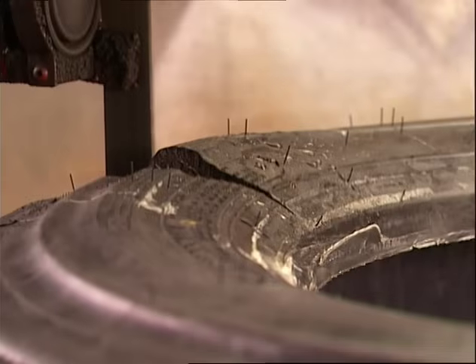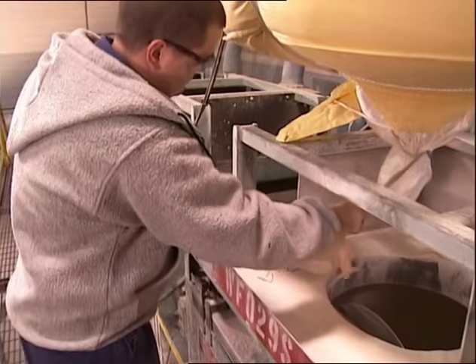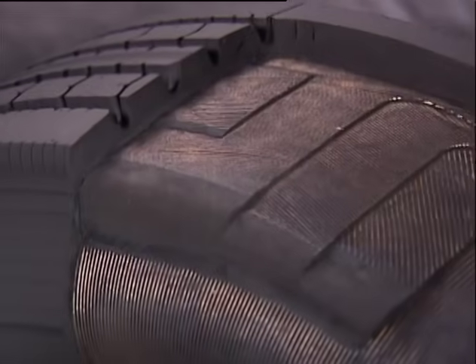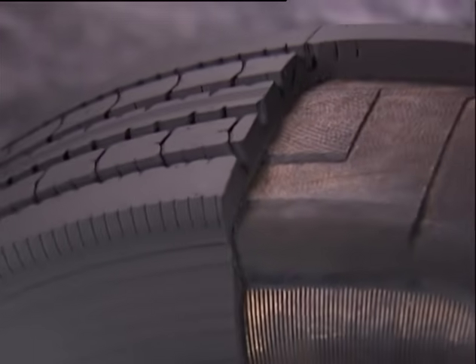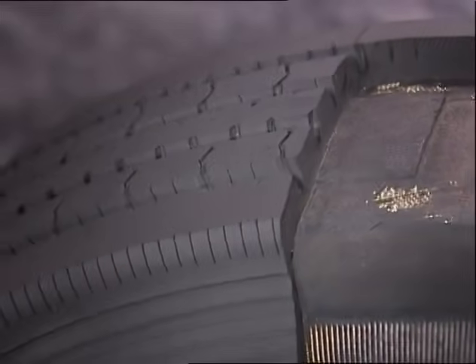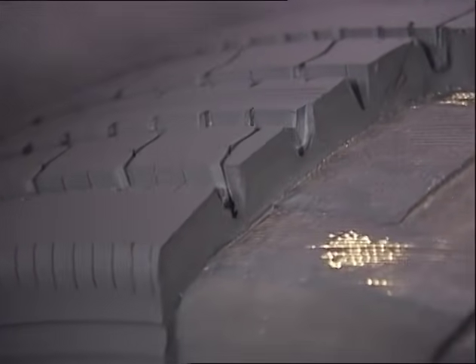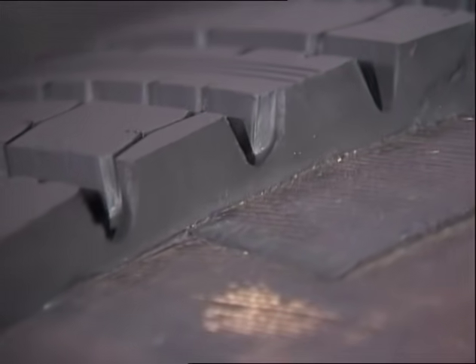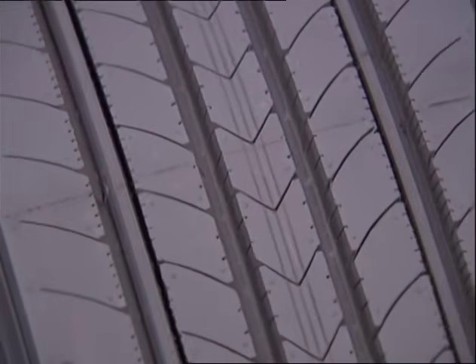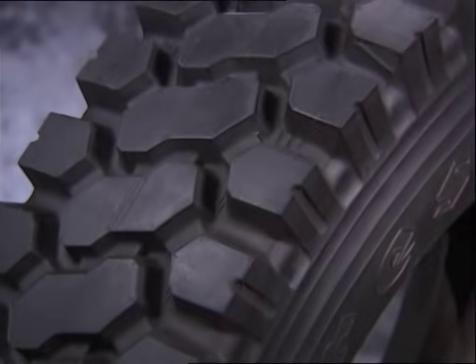To find out, we'll look at what's inside it. Then we'll see what goes into the making of a modern truck tire. We'll start at the outside. The tread, of course, is a thick layer of rubber with a tread pattern molded into it. The rubber is application specific, meaning each rubber compound is chosen for a specific combination of qualities like fuel economy, wet traction, and cut and chip resistance.